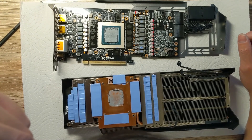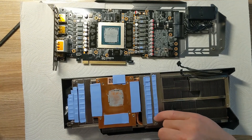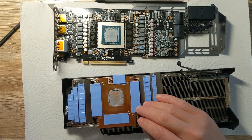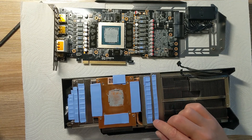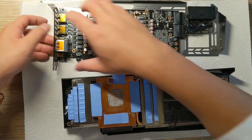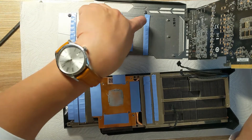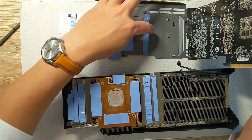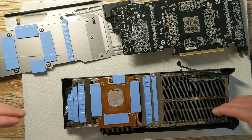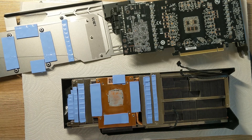I think what it is — out here I used 2mm pads and based on the indents right here, I know that the 2mm is a bit too thick, so it's not making as flush of a contact as I'd like. So what I'm going to do is reduce this to 1.5mm so it doesn't push in as hard. On the back side it looks like the same thing — these ones are not making as much of an indent as the 2mm on the side, so I'll reduce this to 1.5mm as well. I'll take it apart, wipe it down with alcohol wipes, re-pad it, add the thermal paste — make sure you get extra on there.